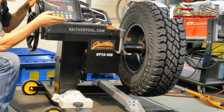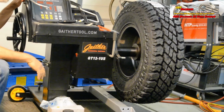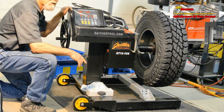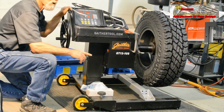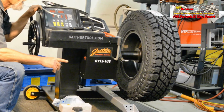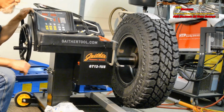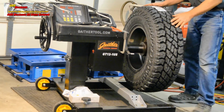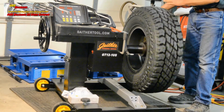Be certain that the wheel and tire are mounted properly and that the bead is seated on the tire. I always spin the tire to check for rim runout, which is really less likely with alloy wheels. They have no tolerance for bending and typically will break before they'll bend. Nevertheless, there is such a thing as factory defects in wheels. So check the runout.